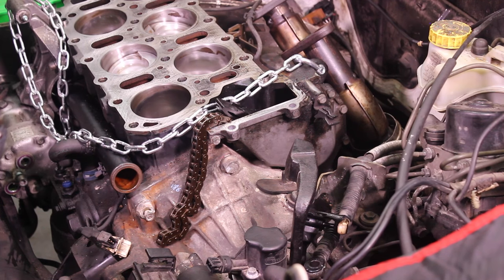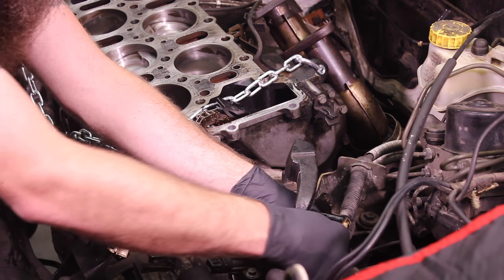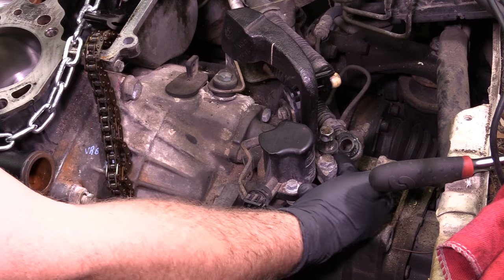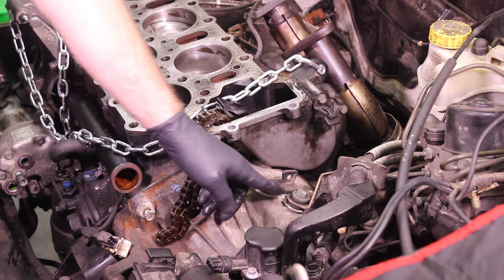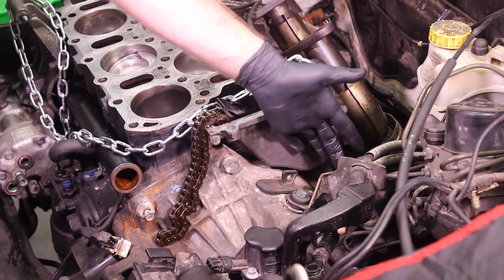This is the washer that you want to make sure you don't lose, and this is the bolt. If you don't have this bolt and just have it threaded all the way up to the top, it'll actually go down and crush the rubber. Like I said, you'll never get it adjusted right. To prevent something sad happening to this, even though it's a pretty unique bolt, I'm going to go ahead and just put it all the way back in. There's a captive nut inside this retainer that holds it on. Now that we have our cables loose from the shifter, we're going to take out the three 13-millimeter bolts that hold the bracket for the cables on.